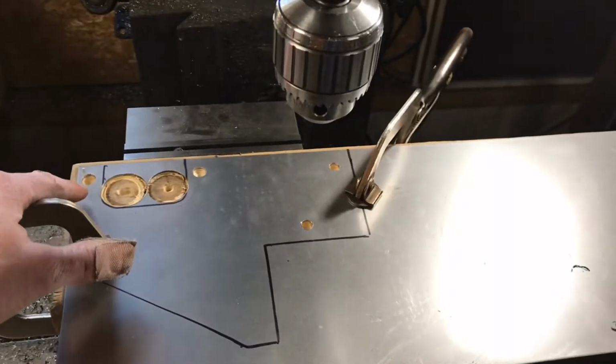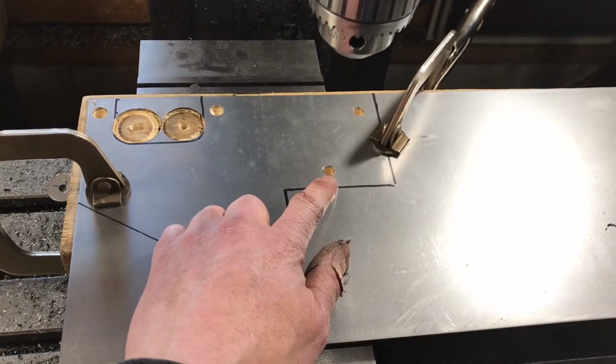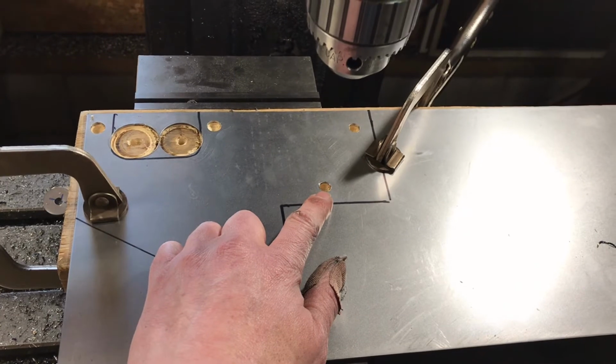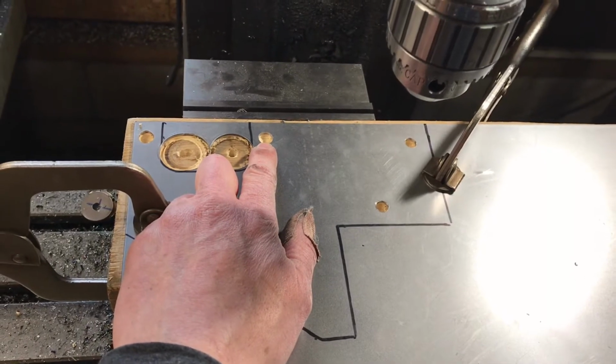Okay, the studs on the brake booster are 3/8. And we're going to use 5/16 bolts to bolt the proportioning valve on to the bracket. And this is kind of the industry standard. If you have a 3/8 bolt, the clearance hole for that should be a 32nd bigger.